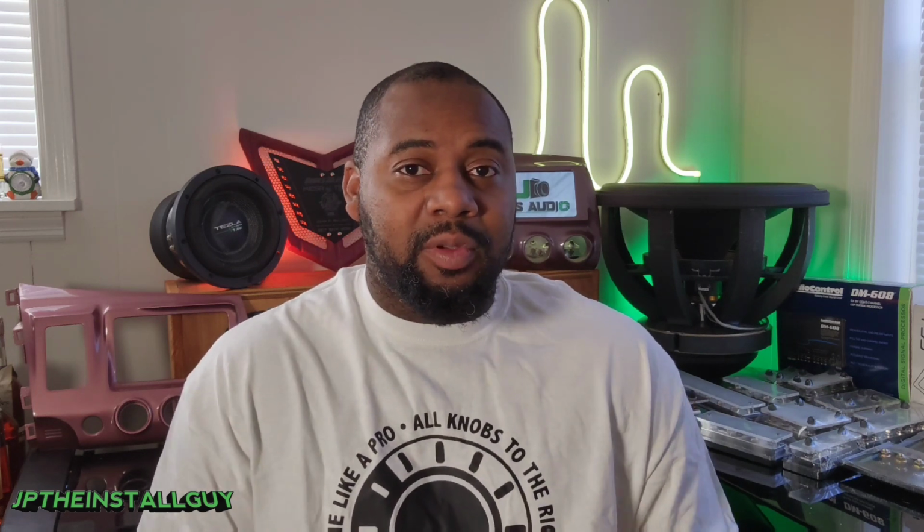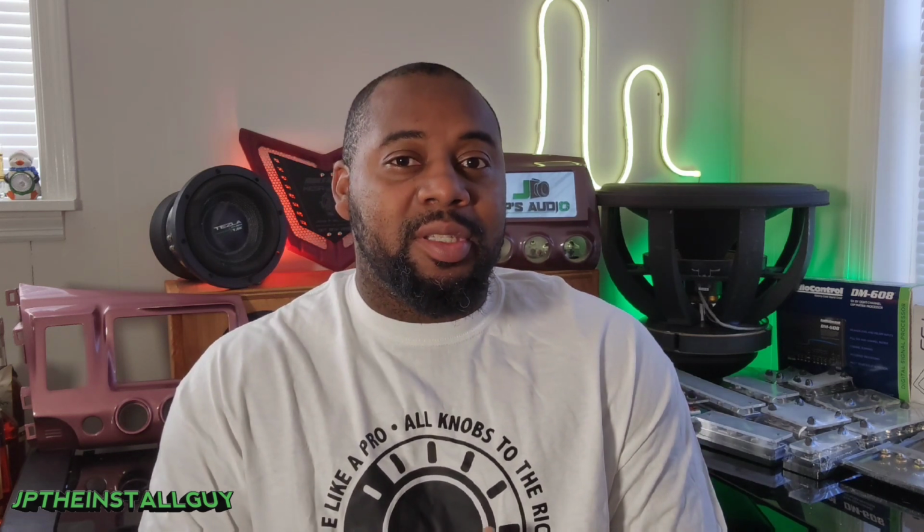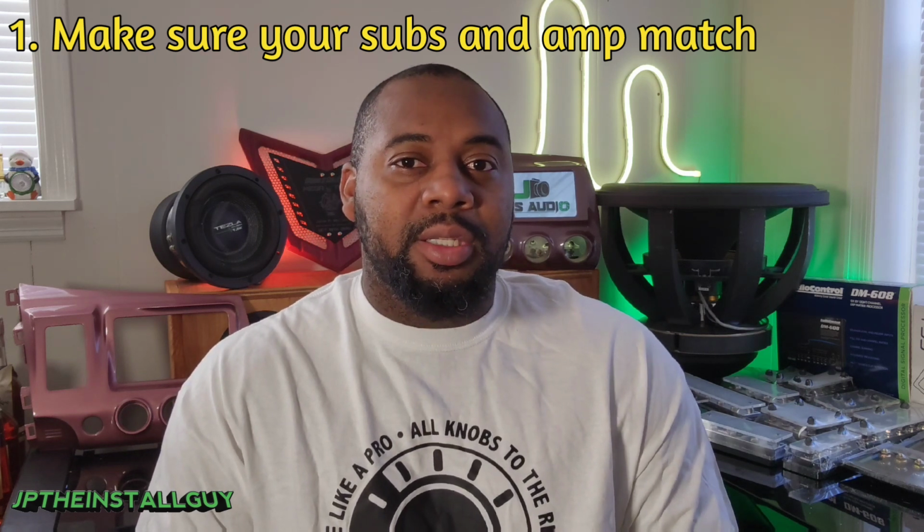I hate to say it, but you probably damaged those subs. The fact that you knew they were distorted, and you had the gain turned up to whatever level and knew it was clipping, after so long the sub can only take so much. Now, I wouldn't necessarily say you need a more powerful amp, because if your signal's not clean, then it doesn't matter how many watts you have. You can take a 500 watt amplifier and clip a sub that can handle 500, 750 watts. It doesn't matter. If the signal is clipping, distorted power going to that sub is going to pop it every single time. So the first thing I would do is start from the beginning.